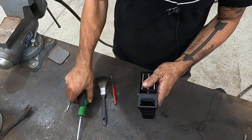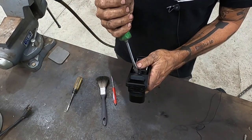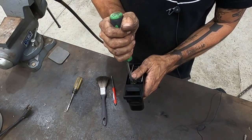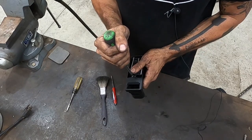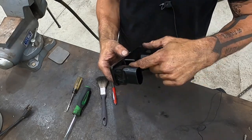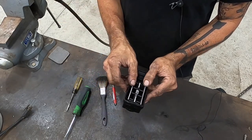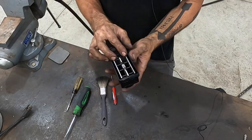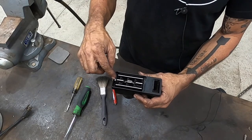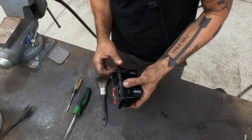Now I'm going to go to the pin on this side and use a wider straight blade screwdriver, putting just a little bit of pressure with the thumb on the center. Twist the blade of the screwdriver very gently — and pop it in, just like that. I can see that it's in the hole on both sides. If you spin it around the other way, that'll tend to help tighten it up a little bit, because these things get worn out over time and start to flop around. You end up having to shove toothpicks or pieces of paper in some vents — just old truck stuff.